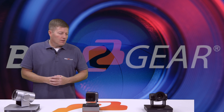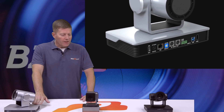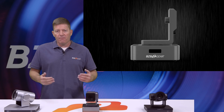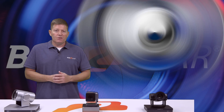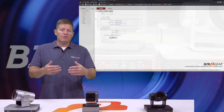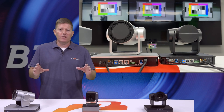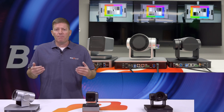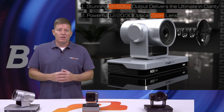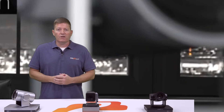What is notably different on these cameras — besides the fact that the 4K doesn't have SDI but does have USB 3.0 and HDMI — is the lenses. These cameras all have different lenses. They also have what's called web GUIs, or web interfaces, accessible via a web browser. You need to network these cameras in order to access that and make various video setting changes. We adjusted our cameras for this particular shot — it was relatively simple. We adjusted the white balance and a little bit of saturation. The 4K camera gives a great image, it looks awesome. I'd love to show you the zoom and autofocus as well, because they're really great.